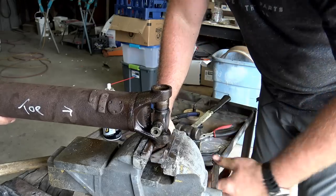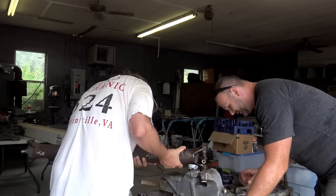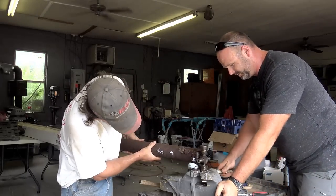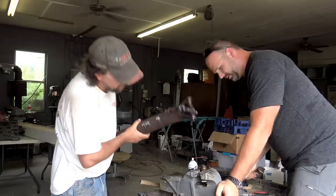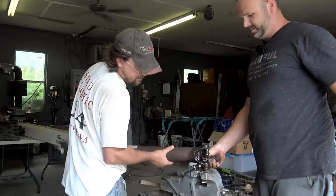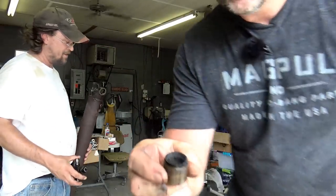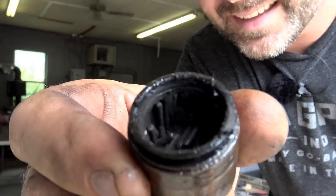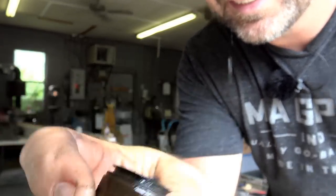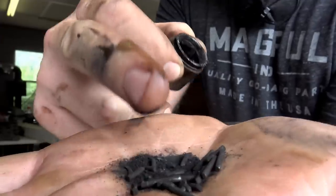It's moving — got it moving now. Let me tap up on it a little bit. There it goes — she sucked right out of there. Look at the dust come out of that thing! There's all the needle bearings — that's what the problem was. That was our shimmy right there. It's just pieces — powdered needle bearings. That's what caused the vibration.